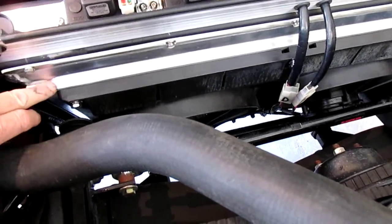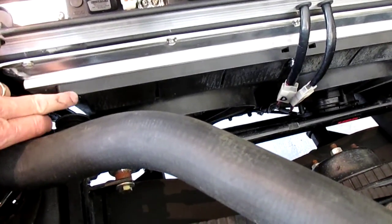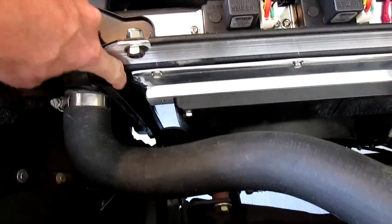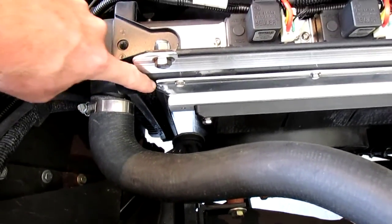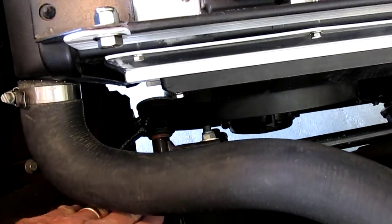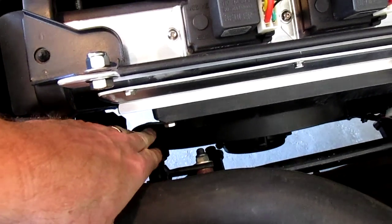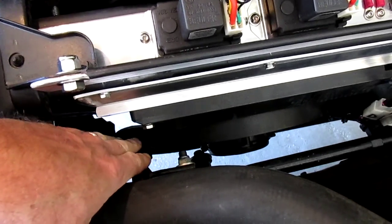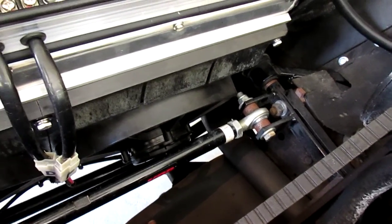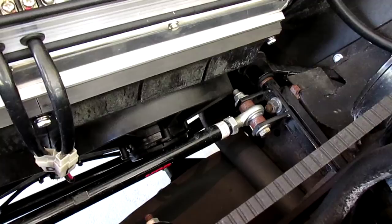Here's another shot of the fans - you can see how the fan shroud bolts here, and the rectangular pieces I put on bolt directly to the fan, which worked out very nice. There's only a small section of the radiator not covered by the shroud - less than an inch on the left-hand side. In terms of clearance issues, you can see where the bushing for the A-arm comes up really close, so you do have to move the fan over as far to the right as possible. Even then, on the right-hand side the bolt from that strut might be touching the fan shroud slightly, but I don't think it's going to be a problem.